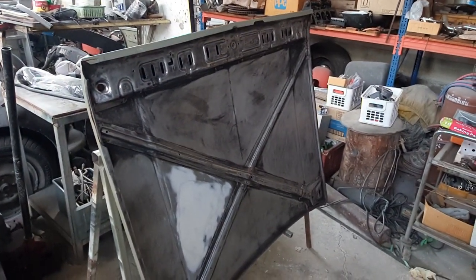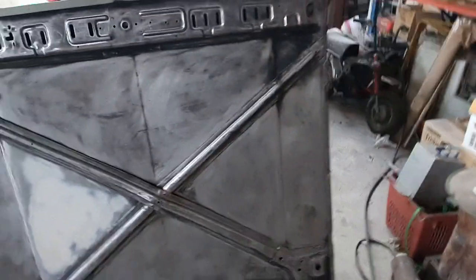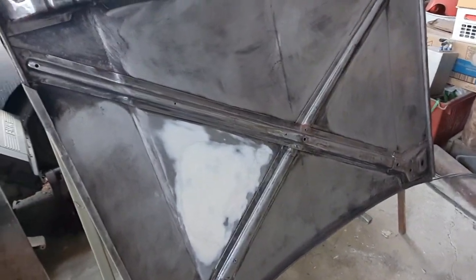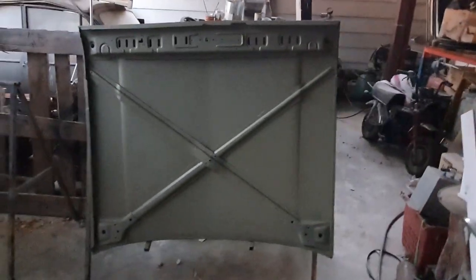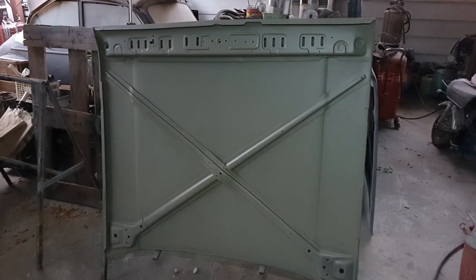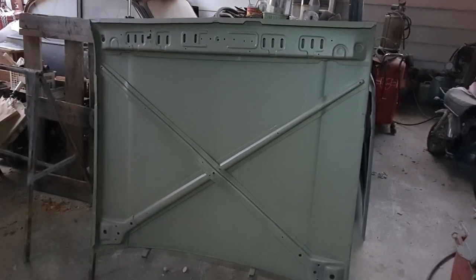I just got on and did all the rubbing down, the prep and whatever, because I've got a delivery coming in and if I don't get this in primer now it could be a couple of days before I get back to it. So I just wanted to smash through it. Now I'm just going to mix up the primer and get it on there - you shouldn't see the damage through that other side now and it's nice and smooth. The light is failing but we've got the primer on there, so that's safe - it's not going to go rusty. We can go back to work and pick this up when we're ready to put the spray polyurethane on it and get it ready for top coat. Next on the list is doing a boot and the front spoiler bib type thingy.